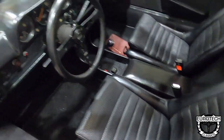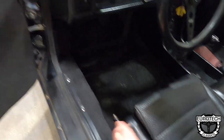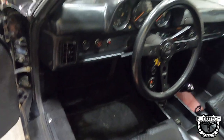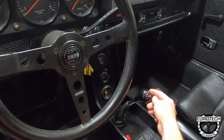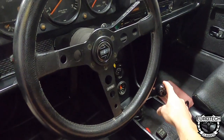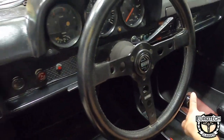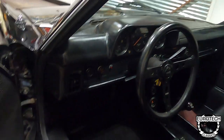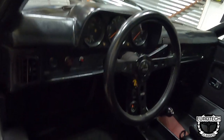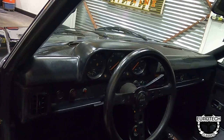This is your engine compartment knob. Your e-brake is actually on the left-hand side — it's all the way up because it's adjusted correctly and doesn't get in the way of the driver coming in and out. You have a dog-leg style transmission, which means first gear is down and to the left. Being that this is a side-shift 914 rather than the early tail-shifter 914, when they're adjusted they actually shift very well. Just go slow with your shifts — this is not a modern car where you can slam the gear. They're long shifters.